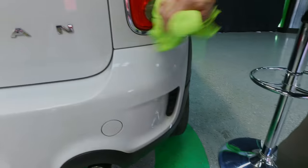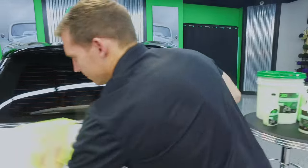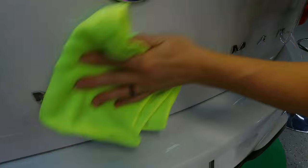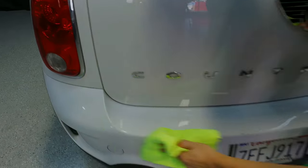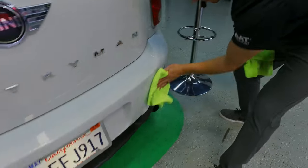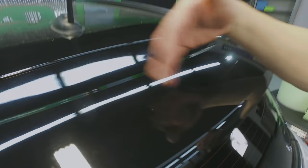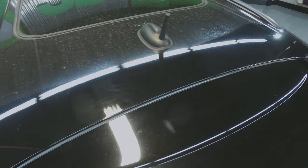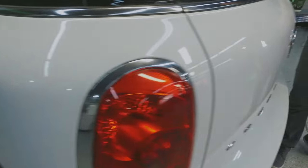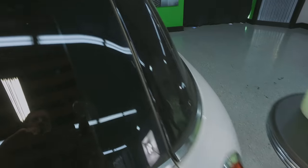You can see you get a good gloss here. One of the things that shows how well this product works is it has a little bit of a fill to it. It's going to leave behind some silicone — some emulsified silicone — and some waxes, because that's what helps glide the product, kind of like ball bearings. So if you were to remove this with rubbing alcohol, you would definitely see a difference in the gloss on the black. That's about as dirty as it gets.